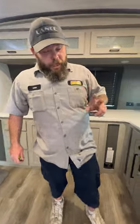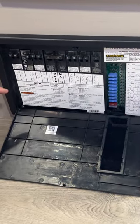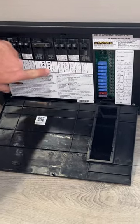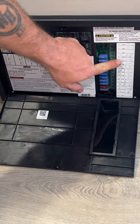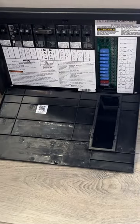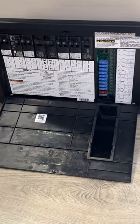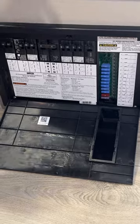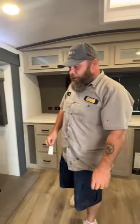Right down here is going to be where our fuse control panel box is located. Basically, everything that runs off shore power — so you have to be plugged in for it to work — is going to be on your breakers, and they have everything labeled for you. Then everything that operates off the battery is going to be on the fuses, and once again, they've got everything labeled for you as well. I would always like to recommend, just as a safety precaution in the wintertime, go ahead and pull the fuse for the fridge. That way, if it isn't accidentally left on sitting in storage all winter, it doesn't completely kill and drain your batteries.